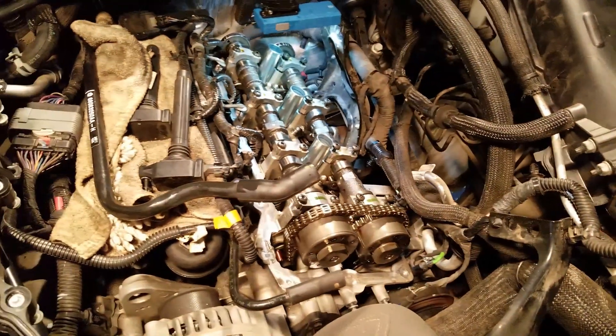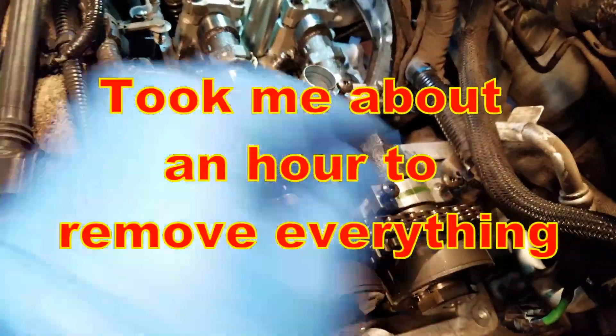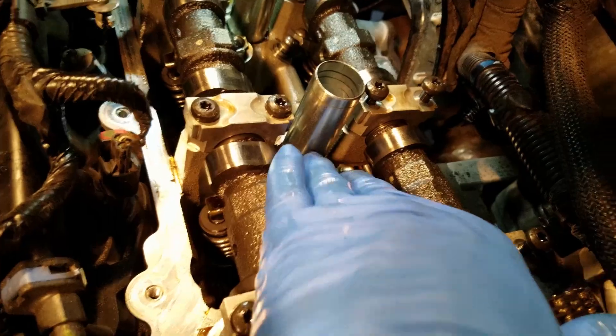Find out if it's bad when you come under the hood here, after you've removed all this stuff. You'll see this is a good rocker arm right here, and the bearing's still good. So when I pull on it, no movement. Let's go over to this one here.